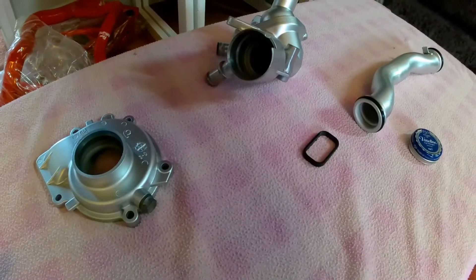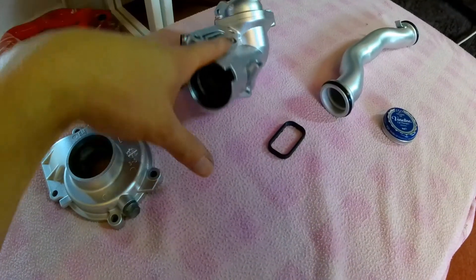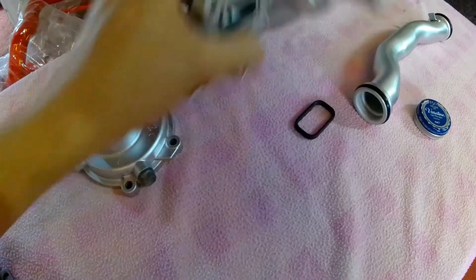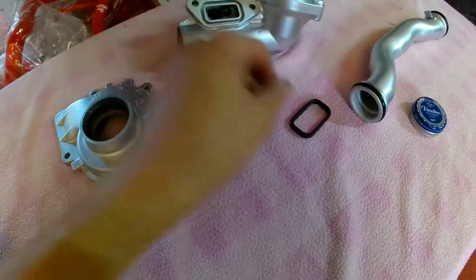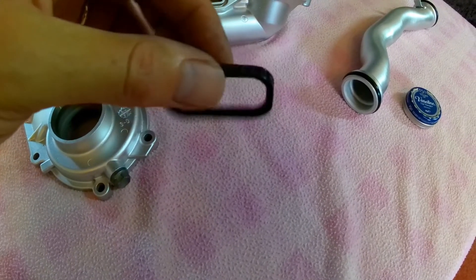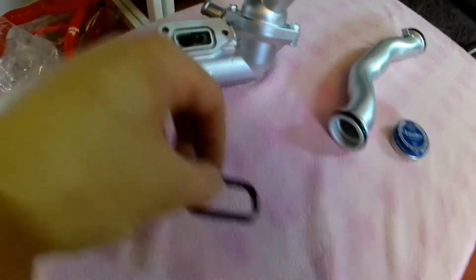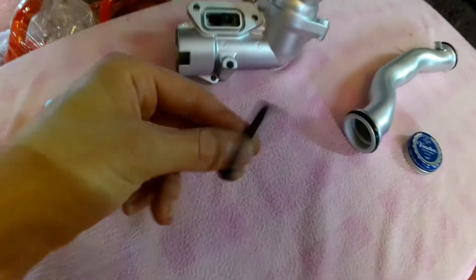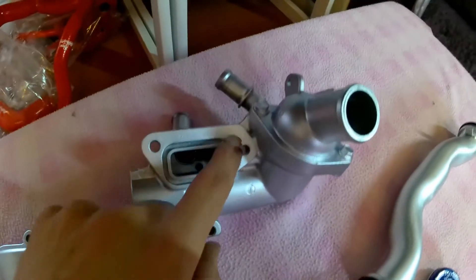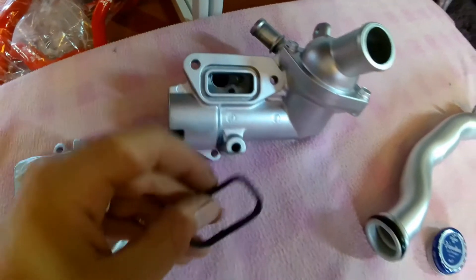I was hoping to get this little assembly back together. This is the water pump, thermostat and housing and the pipe between. I've put some PTFE tape on the drain plug and on the coolant temperature sensor so they shouldn't leak. But what I'm annoyed about is that I had a better seal than this out of the newer engine, but somehow I've lost it. So I've dug this one out of the older engine and it just seemed to sit more flat against that face. What I could really do is get a new seal, but I'm not sure if I can get one or how long I can wait. What I might have to do is just lay a bead of silicone in there to give it a bit of a higher seating point.